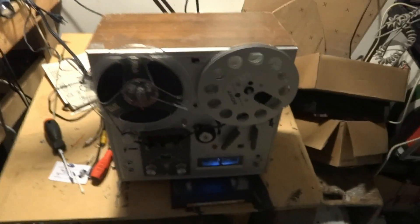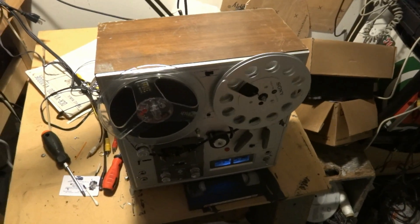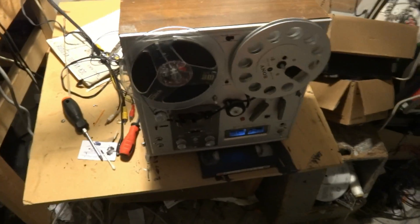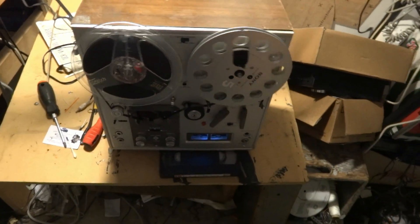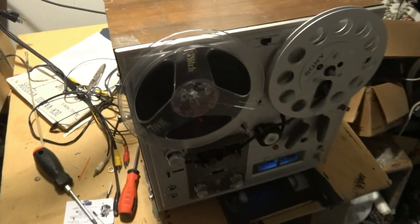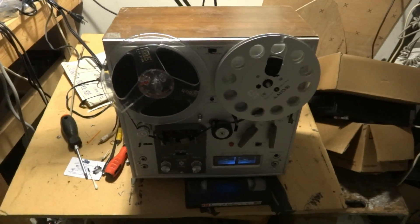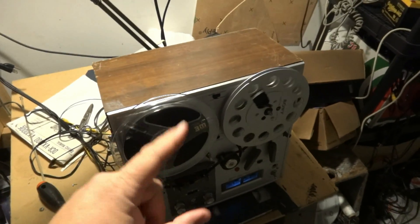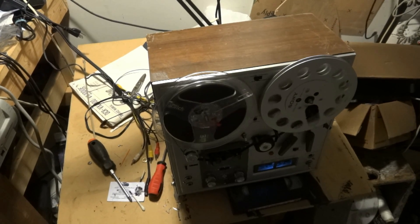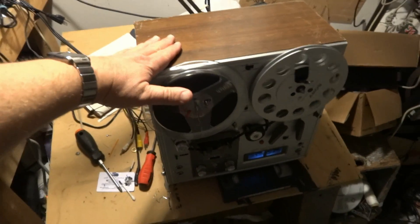There's my 1968 Akai 1710W — restored. With a five-tube amplifier, basically all it needed was lubrication and cleaning of the switches and controls after 46 years. It's amazing the thing works given it's been sitting in storage for at least 25 years without being turned on. As they say, they don't build things like they used to — 46 years old and still going strong. Even though I thought it was going to need a new belt, try as I might I can't stop the capstan from turning — there's more than enough torque to spin the flywheel and hold the tape speed constant. Pretty remarkable. This goes back into my stereo cabinet and I'm going to start using it again.